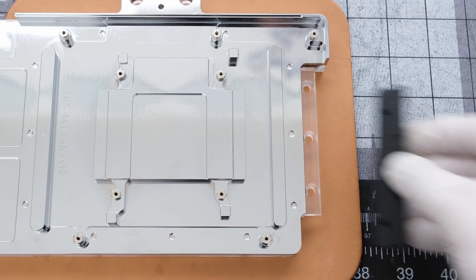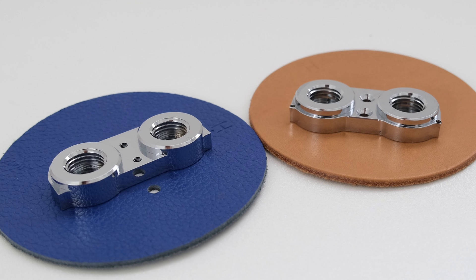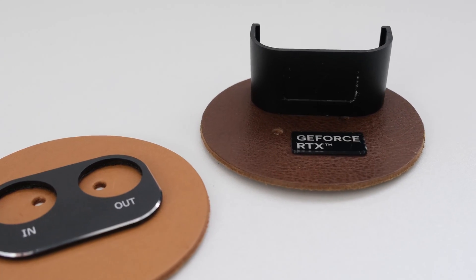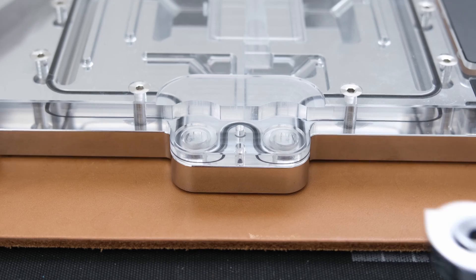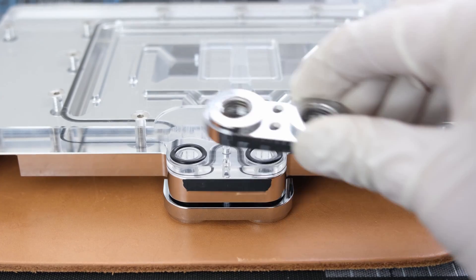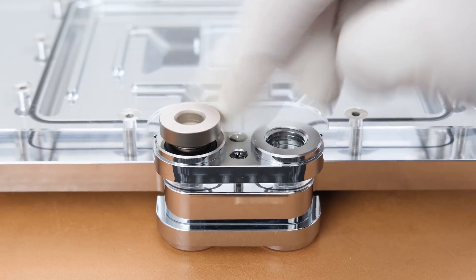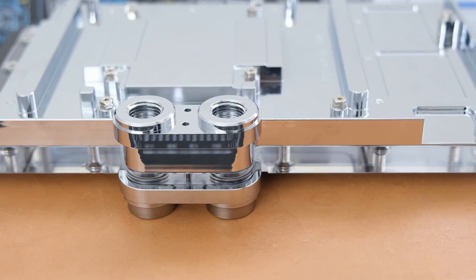Flipping the block over, there is a black acrylic piece to attach for the I/O bracket, secured with 3 hex screws. Next are the chrome-plated brass threads located on both sides of the terminal. The black plastic pieces covering parts of the terminal and the last two remaining screws are not required for operation and were not salvaged. Let's drop a pair of black rubber O-rings onto one of the chrome-plated threads, place that under the cold plate, then another pair of O-rings, and place the other thread right on top, secured with two Phillips-head screws. For now, let's drop in a pair of Optimus plugs for the front and water cooler plugs for the back.